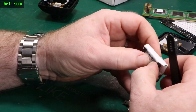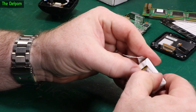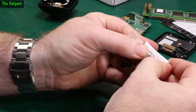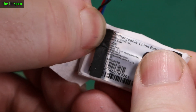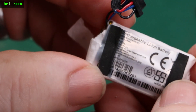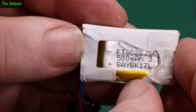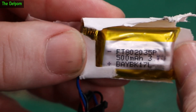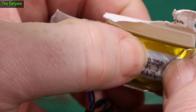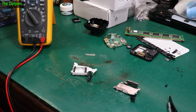It doesn't feel soft, it just feels lumpy. What does it say underneath? 500 mAh, 3.7 volts, 1.85 Wh — that's what I need, one of these. It's interesting why it's lumpy but not bulging. Let's check voltages on that battery connector — there's nothing there at all. What I'm going to do is plug it into the actual board and plug power in to see if it will try to charge.